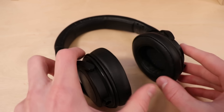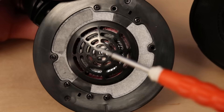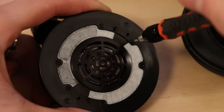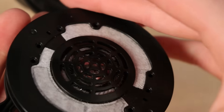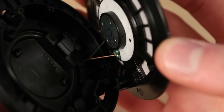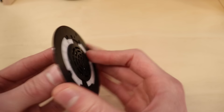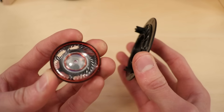So you can see here that we have a pair of headphones, and if I just pull this cup off here, I'm left with this protective plastic grill and housing, so I'm just going to remove a few screws. Now don't disassemble your headphones like this because I'm going to be breaking these in this video. But now that they're open, you can see these two little wires here which I'll have to cut before I can remove the assembly from the headphones. After a little more disassembly, we're left with just this: a protective case along with this dynamic driver assembly.